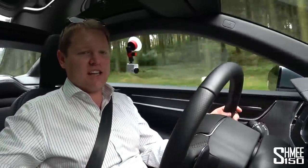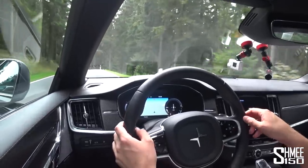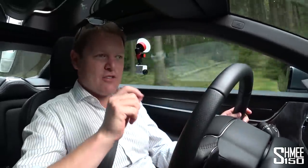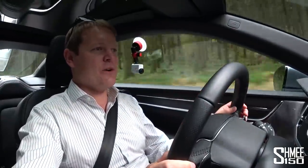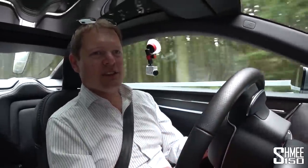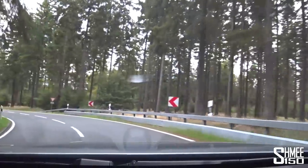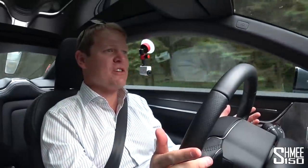And if I go back into, well, let's go into pure mode just for the moment to be fully electric. Engine's clearly off. This is where regenerative braking, I struggle to say that word, is actually quite strong. You can watch the speed coming down quite quickly. And then instant torque and silence. That's the thing that's so strange about this. Some tight corners here just to feel the car through. You can hold a decent speed around these corners without being uncomfortable. And by having it set up like that, the car's doing the majority of the work for me.